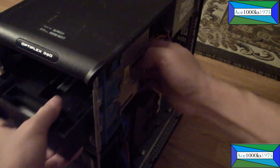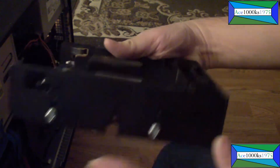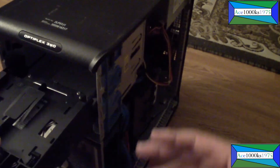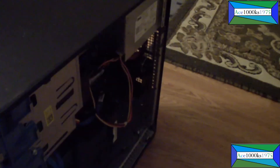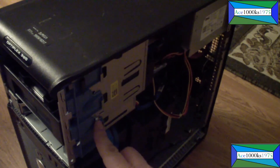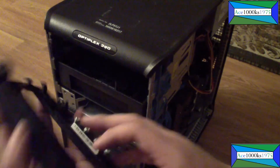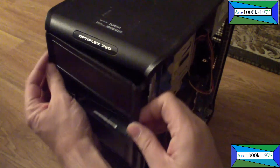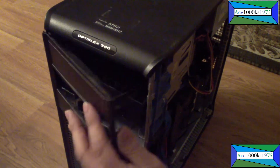Push down and slide this out. The way you put the DVD drive in is you put two screws on the bottom like a rail, and on the other side there's only one screw. Push it in, lock it into place — that one screw on the right side is what locks it in. Then push it back in, kind of like a hinge on a door. It's a bit hard to do on camera but not difficult in person.